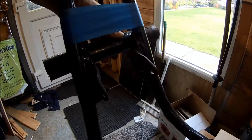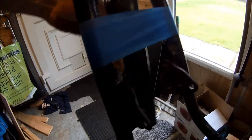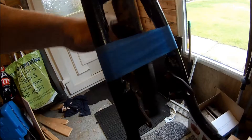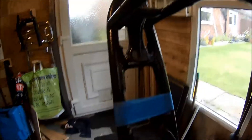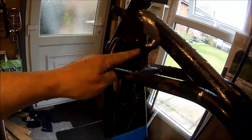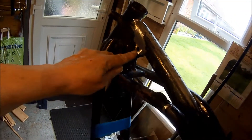If I have to shave a couple of mil off the bracket I will do, because that's only the front engine support - it's massively strong anyway. So once that's in there, I'll shape it to match here and to match the one at the bottom, and that will be my downpipe. And then over here, across this angle and across this angle in heavy, heavy plate - because I've lost rigidity. So this needs to be very heavy to help support this coming down, because this stuff here is only pressed steel. You can see the thickness through that hole there - it's fairly heavy duty but it's nothing like this stuff.